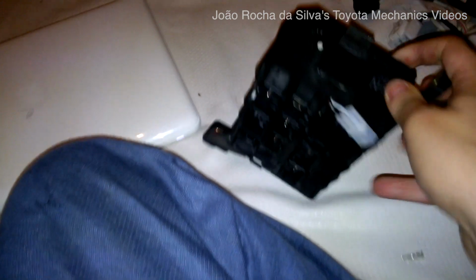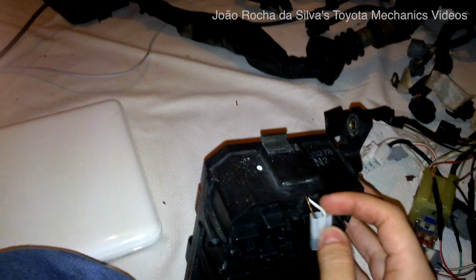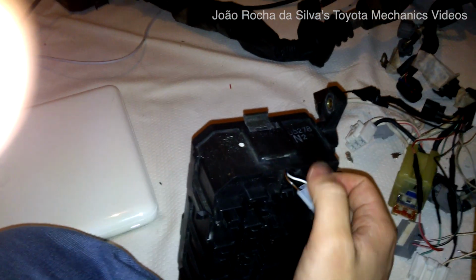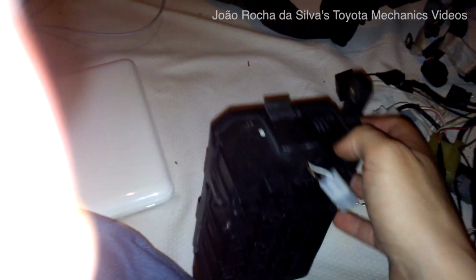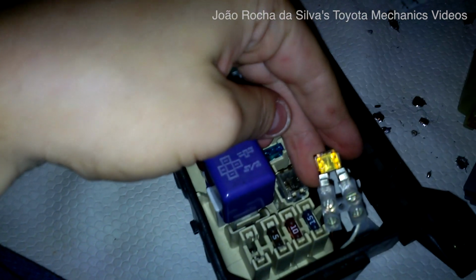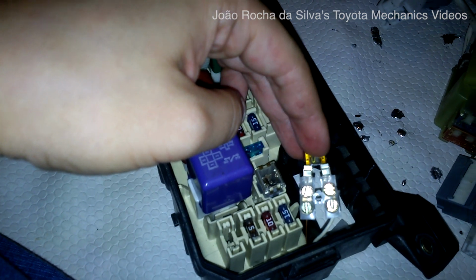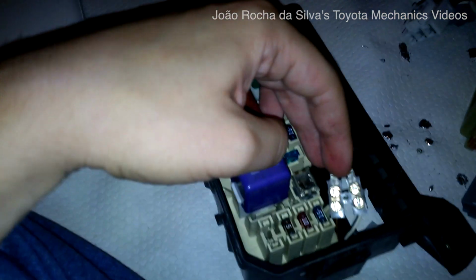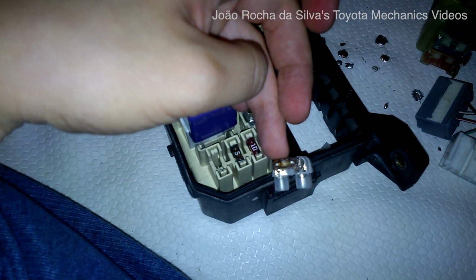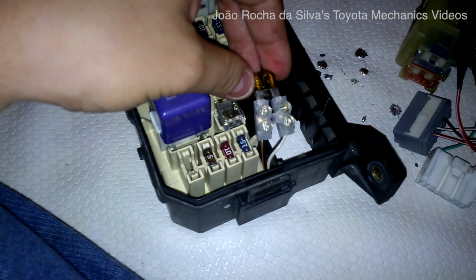Then I have put an extra terminal, you see, with the wires, the ones that go into the fuse and the exit, one on each side of the fuse. And then on the other side we have this connector that I have improvised from a couple of female pins from the other fuse box, and the connector, as you can see. And then there is a 5 amp fuse, which is the rated fuse for this idle up thing. So I will insulate this with electrical tape.